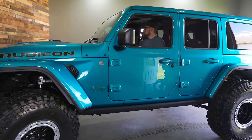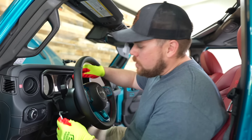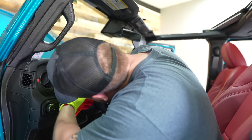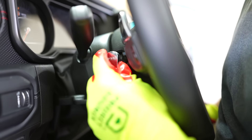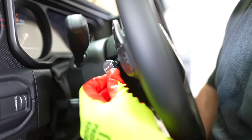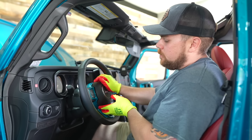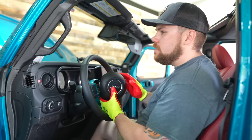The first thing I did was disconnect the battery. We're inside the Jeep — I've got a small pick and what we're going to do is go right behind here. There are small little tabs on either side of the steering wheel. Pulling that out, you can expose right behind there, which is a 10 millimeter bolt. We're going to go ahead and get on here with our 10. Once you have those off, now it's time to pull the airbag cover off — pull it out towards you.